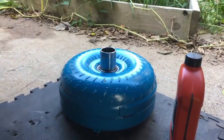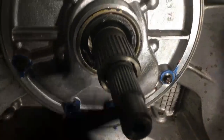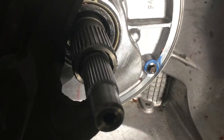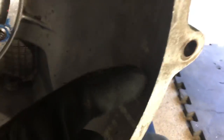Next thing is the torque converter, which I have right here. This is a double clunk — basically you put it on and it will align on the first set of splines, but it also has to line up on a second set further back. What you'll see is you put it on, it fits, then you keep rotating it slowly and it will go clunk and drop into the last position. The big thing is it has to sit inside the bell housing. The back is up against the flex plate, and the torque converter has to be in there — see that bolt sticking down? That's what bolts into the flex plate, so those really can't stick past the bell housing.